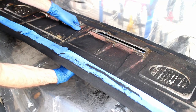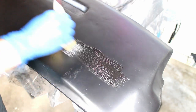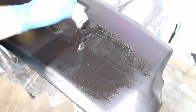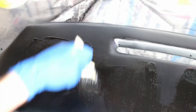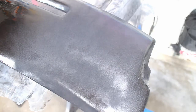Carefully flip the dash and avoid laying the pad where the wet glue and flock was just applied. Apply glue to the top of the dashpad — I used a brush, but I realized afterwards that the brush lines showed up after I flocked the dash. A roller or spray gun is a better option for applying the glue. Apply a liberal amount of flock to the dashpad — more is definitely better in this case.